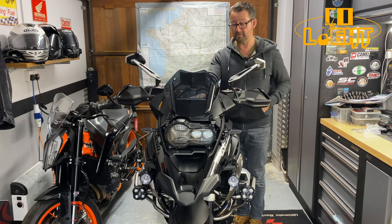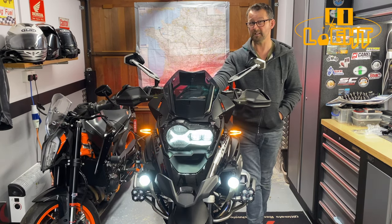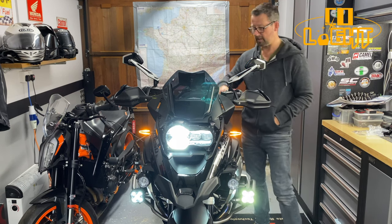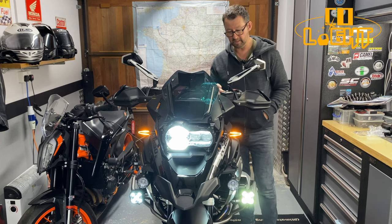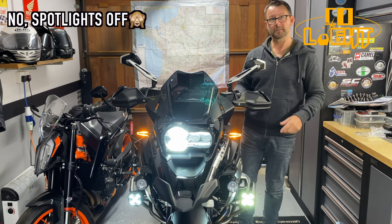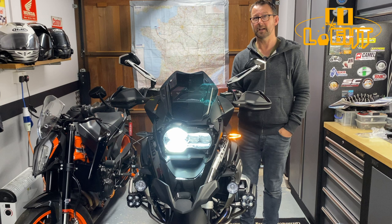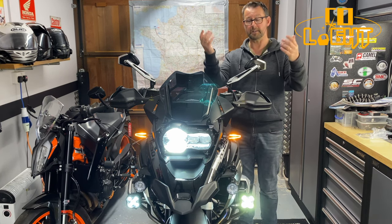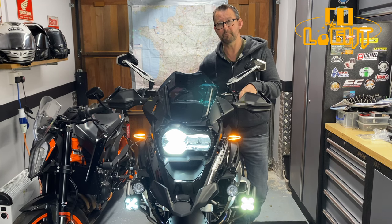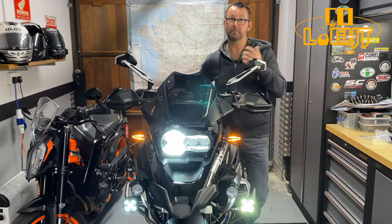If you're thinking about getting them for your BMW or any high-end motorbike and wondering if they do everything high-end lights do - let's have a look. I've reprogrammed the accessory manager so those two lights turn off the indicators when the indicators are on, giving oncoming traffic better visibility of the indicator. And on the high-end stuff, if you want to pass somebody you can flick your headlight high beam three times and the lights will strobe. Do they do it on these? There you go - they strobe as well.